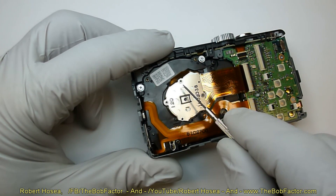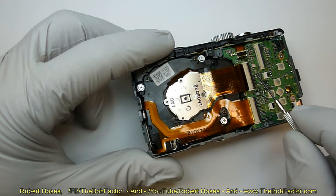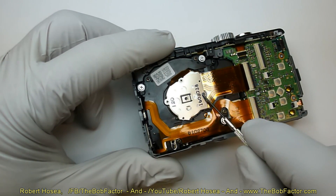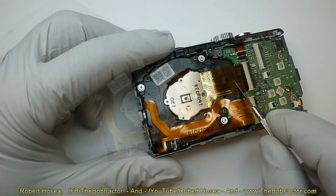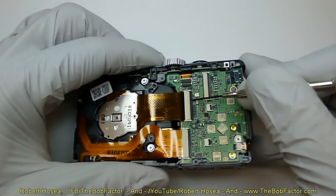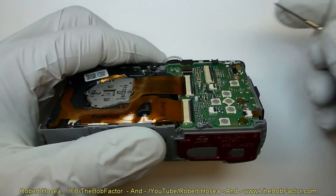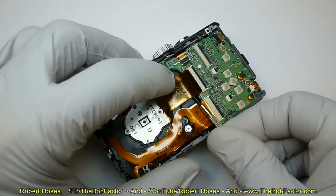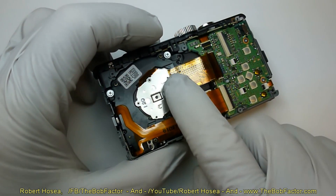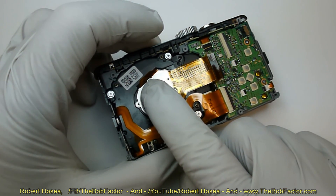This part here is the CCD unit — it grabs the image from the lens optics and sends it to the electronics. If you have a problem with dust on your pictures, there's a good possibility the dust is on the CCD unit. Before removing the three screws, disconnect the flat ribbon cable by putting a small screwdriver underneath the black tab and lifting it. Then put the screwdriver under the flat ribbon and lift lightly — it comes right out. By disconnecting it we can remove the CCD completely, confirm it's clean when we're done, and get better access to the lens directly below it.